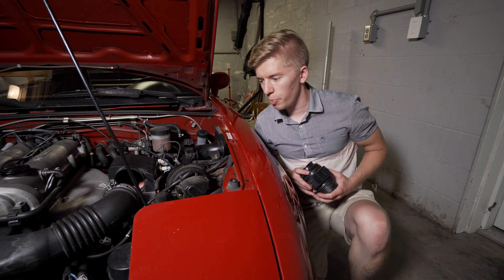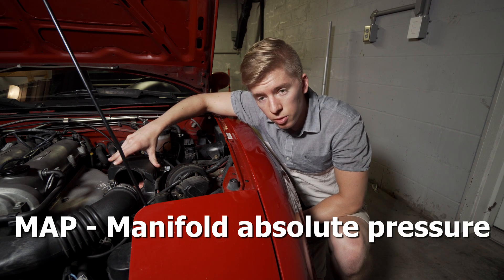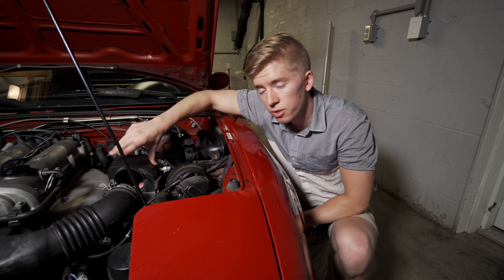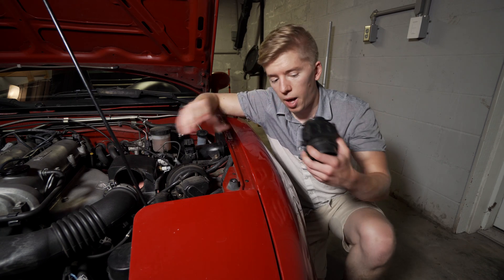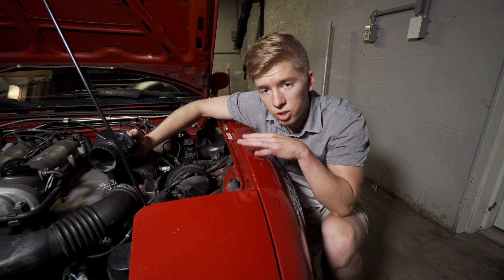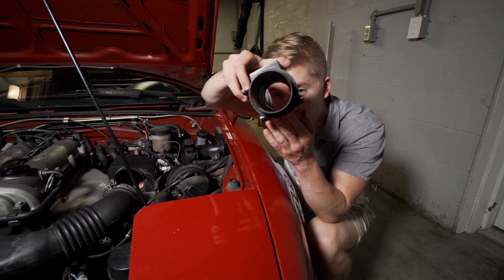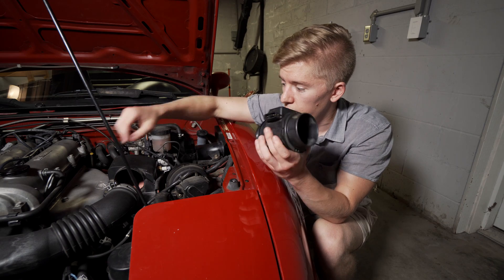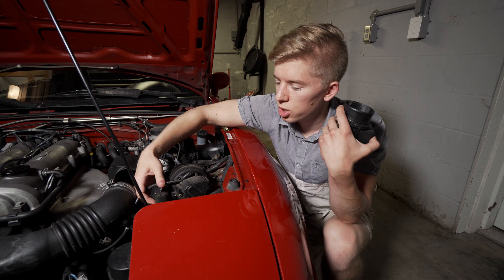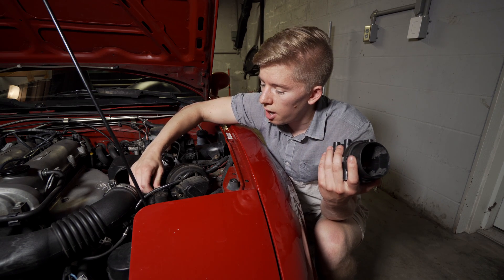The final piece of the Megasquirt puzzle is deleting your MAF and installing an intake air temperature sensor. Megasquirt operates off a MAP sensor measuring pressure in the intake manifold, but to get the full picture of airflow it also needs temperature. I kept my original MAF as the connection point because I wanted to run the car naturally aspirated before we boost it. I used a die grinder to hollow out the MAF so it's no longer restricting airflow. You can use the original MAF wiring harness for the intake air temperature sensor — it's pins 3 and 4, and polarity doesn't matter.